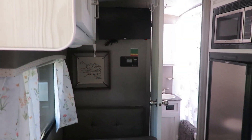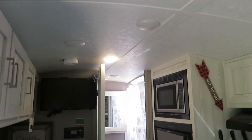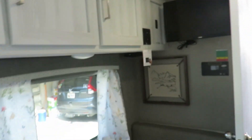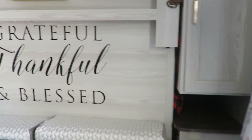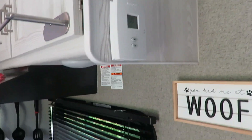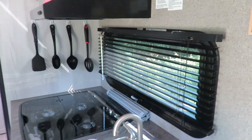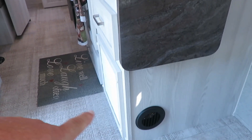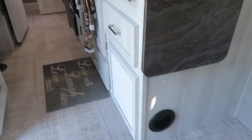Going inside, pretty much all your lighting is run by the 12 volt system. In my particular setup all my puck lights in the top are LEDs and you can turn them on as needed. All those lights inside your camper, unless they're plugged directly into a 110 socket, are running off the 12 volt system. You might think the gas furnace runs strictly off gas, but it actually has a blower motor that runs off 12 volt.